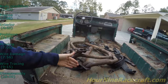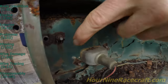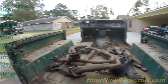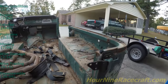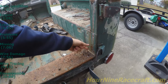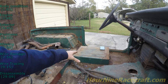Coming off this back door — there was a ground wire connected to the little license plate light assembly going over here, just bolted in right there. I cut that off — they might have done that just for a better ground because it might not have been grounding well where it was. You can see this paint is still burnt where we were heating these screws to loosen them. Along the bottom, somebody had riveted in a plate — you could see it in the other video — we're thinking it just covered a huge rust hole.